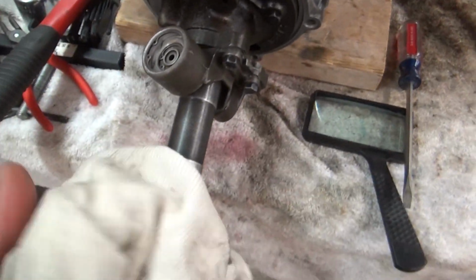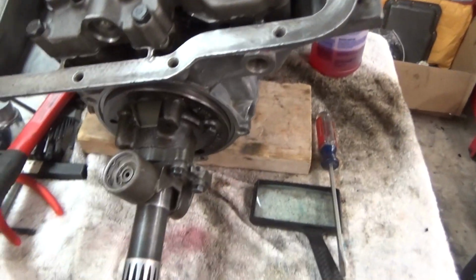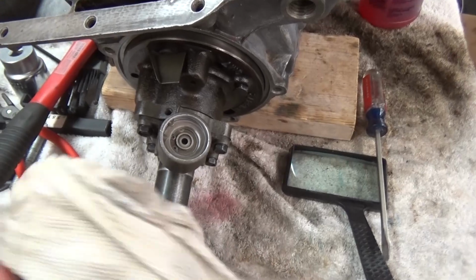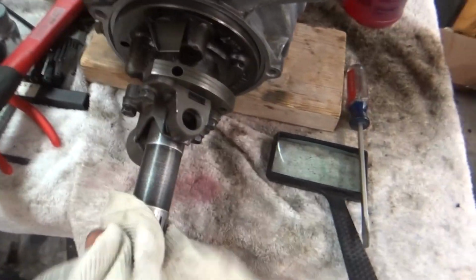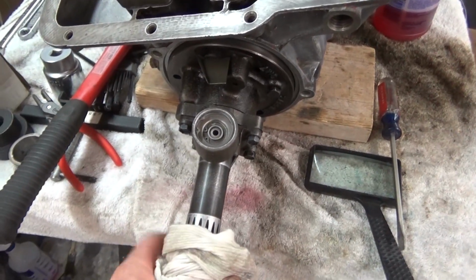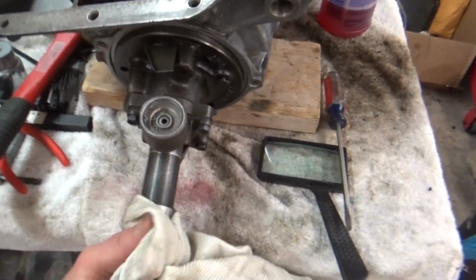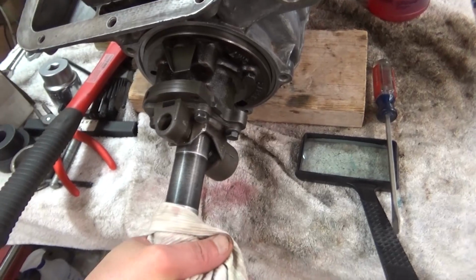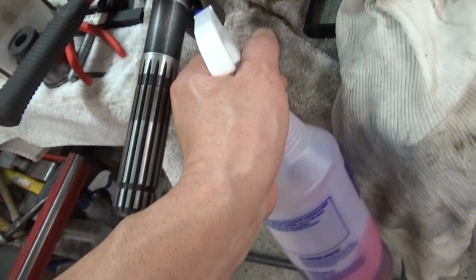As you turn the shaft, take it in gear, that's supposed to drop, which it does, and then it drops down. You can hear it when you come back around. It drops back down. So it's working good there, but when you lube it up with transmission fluid, then it sticks. I mean, it's going to get lubed up with trans fluid, I would think, because what I did, it was sticking earlier, and then I just squirted some transmission fluid in there, just like that.